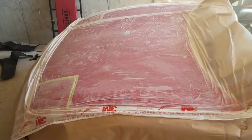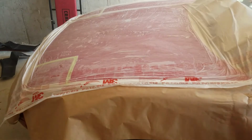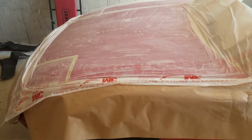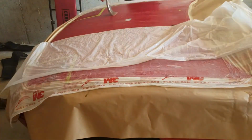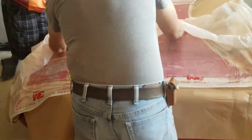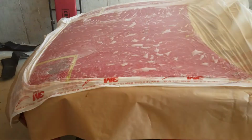But you'll see the way that I painted it on, the brush was way too vertical, and you don't get that much of the paint stripper onto the surface when you're painting it like that. But if you put the brush at a really shallow angle, then it gets a lot more of the stripper on, and then you can do just one coat instead of, I think we did like 3 coats on this.